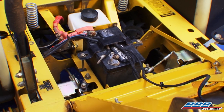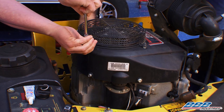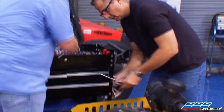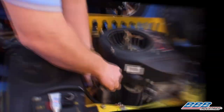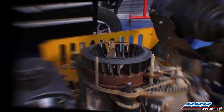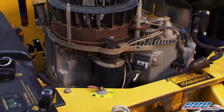There are a couple bolts on the back. We're going to pull this whole shroud off. You might not have to do that — there are two bolts you may get to with some swivel heads down here — but we're pulling it off so we can show you exactly what's going on with the starter motor and you'll get a better look at it. Now you can get a really good shot. You can see the actual pinion of the starter right here and the flywheel.